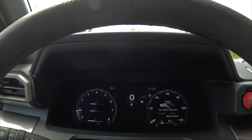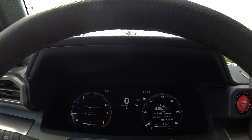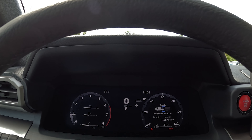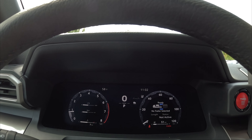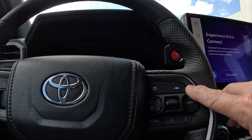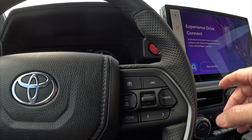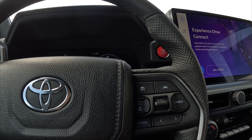If the car in front slows below your set cruise speed, you'll maintain that same safe distance and slow down with them. You can change the distance setting — for example, in a busy city like Portland, you don't want to give someone ten car lengths on the freeway, so you can reduce it down to the one setting, which is roughly three to five car lengths. You also have a button to change cruise control speed plus or minus one mile per hour at a time. The mode button controls the stereo source — hitting it cycles through AM, FM, Sirius satellite radio, and Bluetooth for streaming music from your phone.